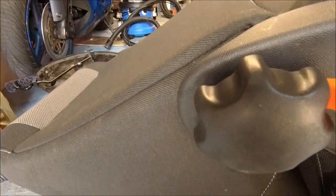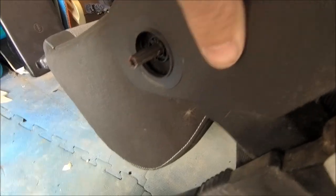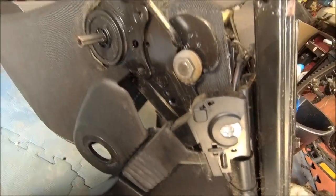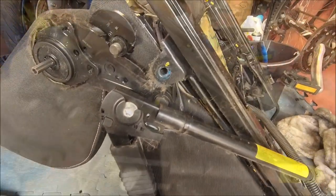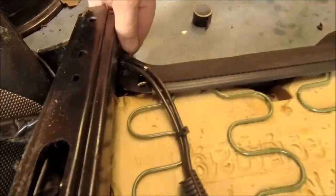I took the bolts out on the other side, just need to pop that off just like that and give it a bit of a pull - that should come straight off. There we go, clip at the back and that pops off. One bolt. The seatbelt and pre-tensioner loosened off as well because I need to get under there. Just for reference, that one there is an 18 - a bit of a weird size, it'll catch your eye out I'm sure. There you have it, one seat in two parts.